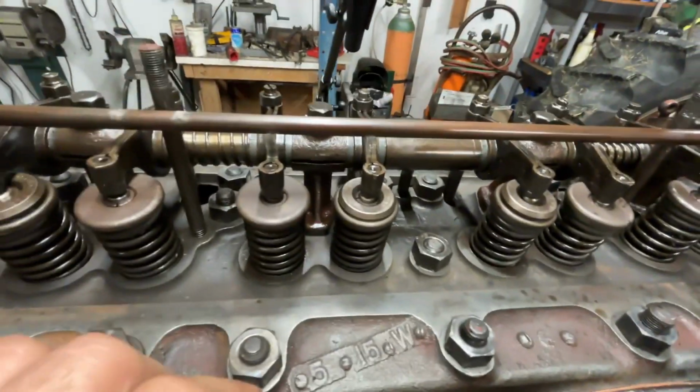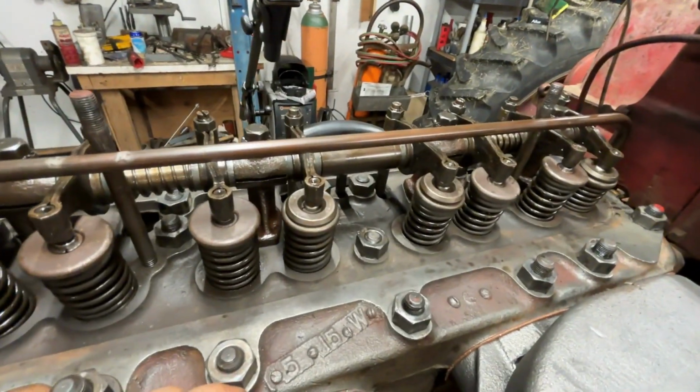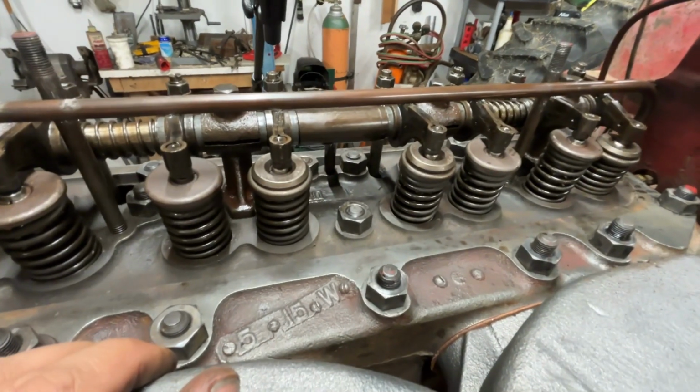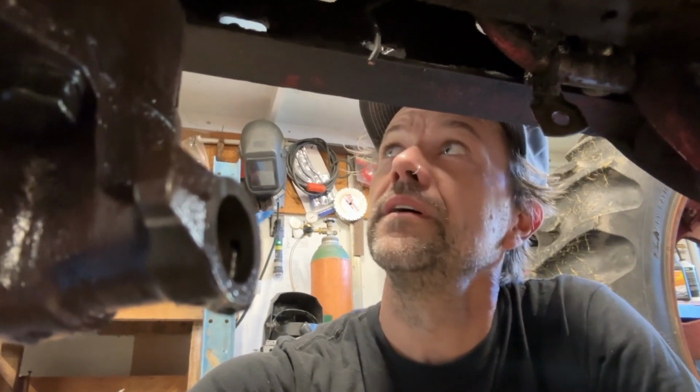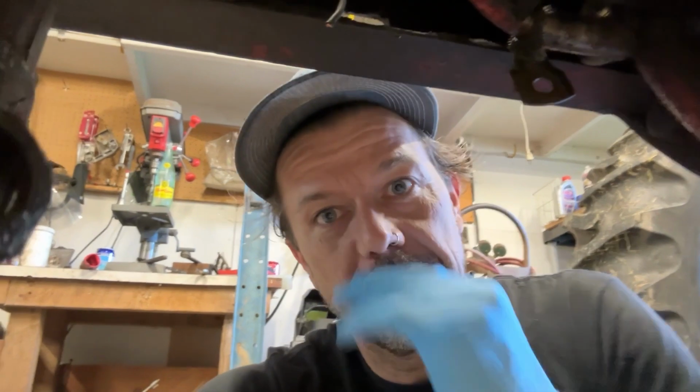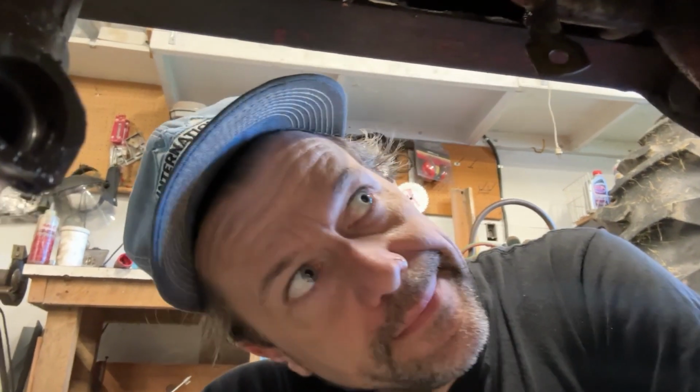I still have to put the oil pan back on, get all that done and prime the pump. And it looks like maybe some coolant stuff, but we're getting there. Okay, so I'm underneath the tractor now, and the GoPro was making some sounds like it's unhappy and running out of battery. Since the top end is pretty much done, except for some coolant lines, fittings, thermostat, etc., I'm putting together the bottom now, getting the oil pan and everything set.